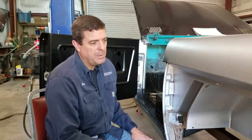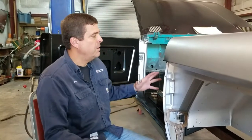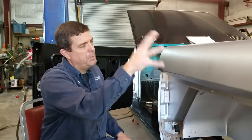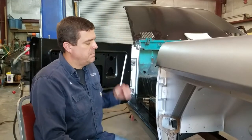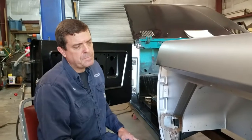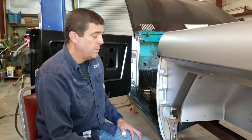There probably won't be a whole lot of narration on this one because it'll just be welding, but I'll stop and tell you where I'm at. I'm going to do the b-pillars and the rear support first and get all that locked in place, then come in and start welding out the tub, then weld the floor out. Everything's got a place to spot weld it, so I'm excited to get to this point.